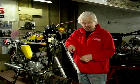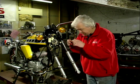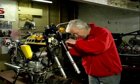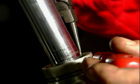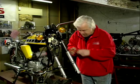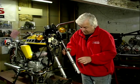Now on this one, in order to separate that, there's a circlip pin here that I need to take out. So I'm using special circlip pliers for that. They just pop in there. This is just a slightly tricky little job, so I'm going to use a little screwdriver to help me pop that out. Oh, there we go, it's come out quite nicely. And on this bike I have cheated slightly by removing the spring and gaiter, which normally lives on there.